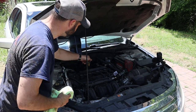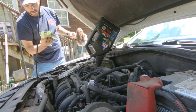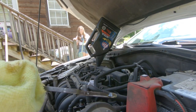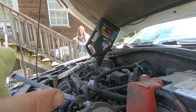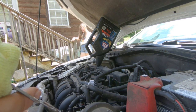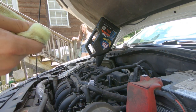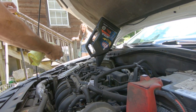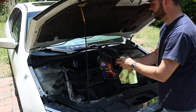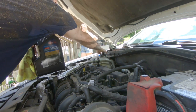Make sure you check your dipstick — make sure it's all going in there and you can see what you've got. Right at the fill line. You've got the little hashes where if it gets into that area it's too low, and there's a little notch here and a little notch there that tells you right where it's at. It's a little bit difficult to see — it just looks wet, has a little bit of coloration to it — but it should be in good shape. That's right where we need to be. Pull that out, grab this, put our cap back on. That's important.